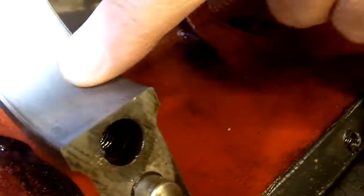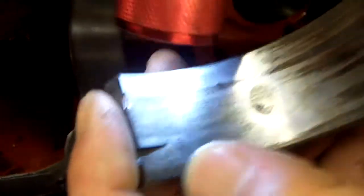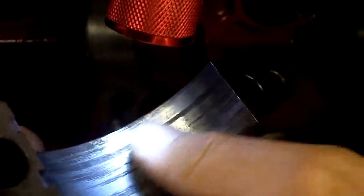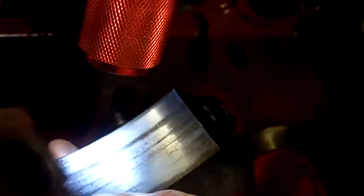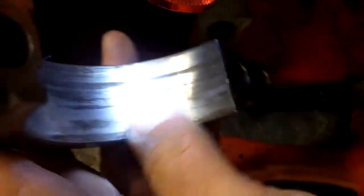Come at this angle — you can see the machine lines here. It looks like tool marks. You can vaguely see them in this one; it's almost like it's been polished a lot. And in this area right here you can see them, but the rest is slick with heavy grooves — this has had a bearing that has spun in it before. You can see the machine grooves here, and you can see they're just gone, polished over.